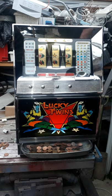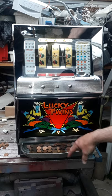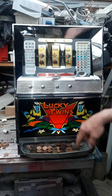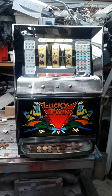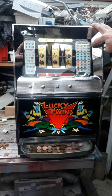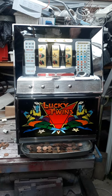Because it was a lot of money back then. Now this one, because it's on a payout hopper - it's basically a disc with pegs on it - the coins are all just shoved in there any old how, and as it turns it collects the coins one at a time round the edge, one after the other all round the edge. And then as they come round the top, they go past the thing which clicks for how many - each time it goes past it clicks, and that's how it counts how many coins it's paying out. So even though you've got like low wins - 4p, 8p, 16p, 32p, 50p, which is quite a lot in the way of because it's 2p - that would take quite a lot in the way of payout sliders and quite a mechanism. But with this, with it having the hopper, you can have any amount of coins in there and a larger payout as you really want.